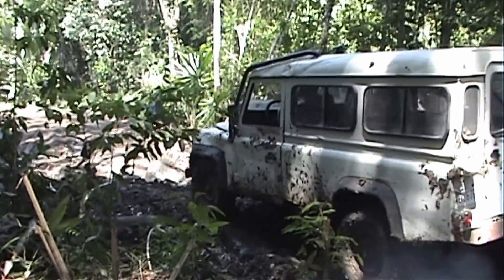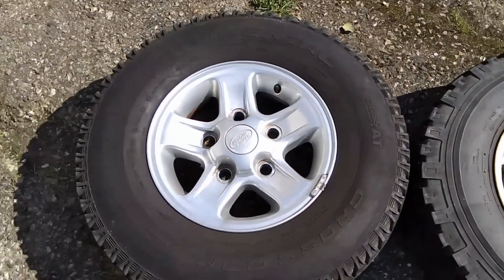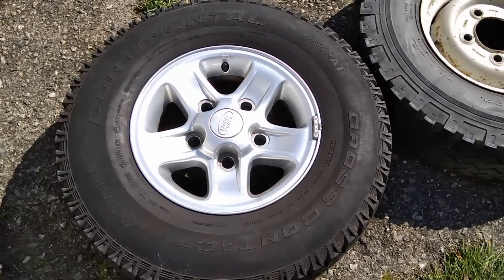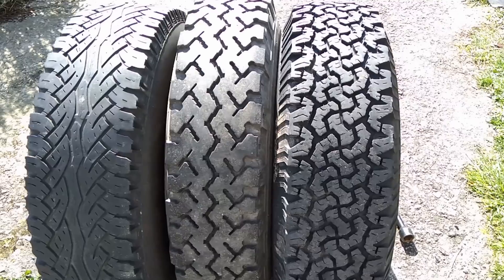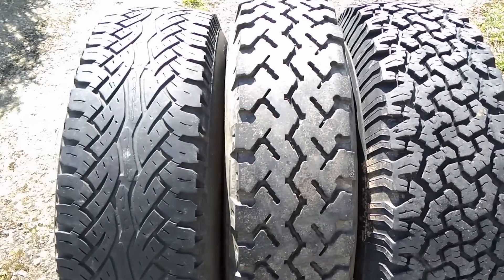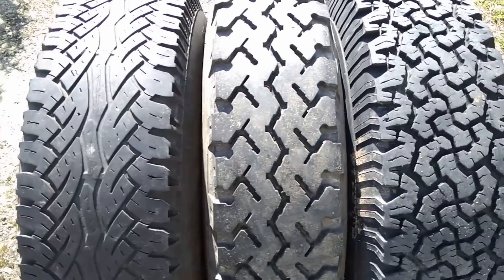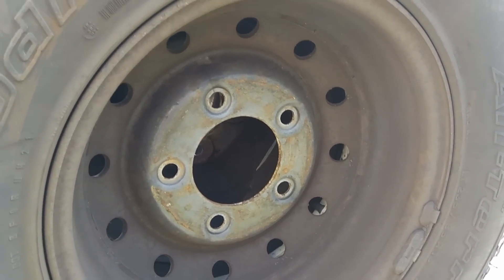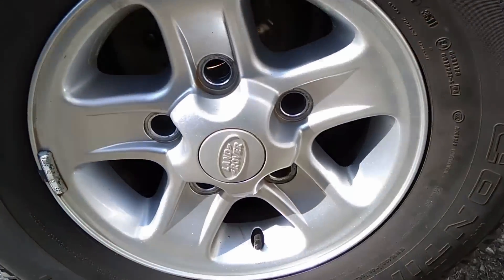I ran steel wheels in Belize and we had no problems. You can get a bit wider tyre on the Wolves because they're wider, and on the Boosts too - these allow the fitment of the widest tyre of all these rims and they look better. You can see the difference in width of tyre the wheels allow you to fit - on a seven inch rim the sidewalls bulge a bit more than on the six and a half inch rim. I'm not going to talk about offsets because that gets complicated, but suffice to say if you fit any of these three wheels with standard tyres you're not going to have any clearance issues on the body.